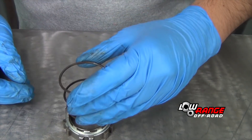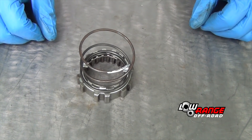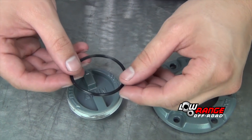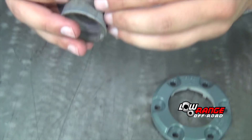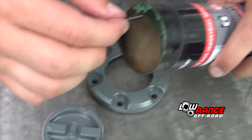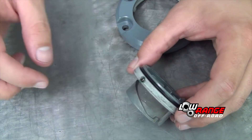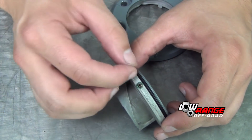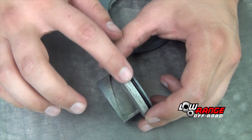Install the handle spring with the smaller end against the pawl and set this assembly aside. Next, we'll install the handle in the hub cover. This is done by installing a new seal on the handle — be sure that it sits squarely in the groove and is not twisted. Apply a small amount of grease to the spring and insert it in the handle hole; the grease is to keep the spring from falling out during assembly. Then install the detent ball on top of the spring and apply a small amount of grease to keep it in place as well.